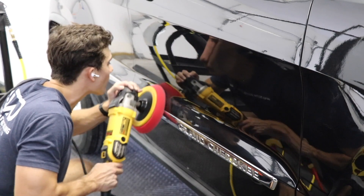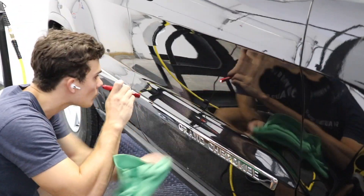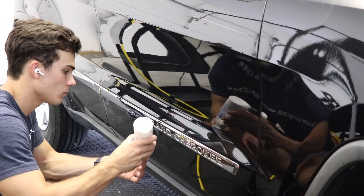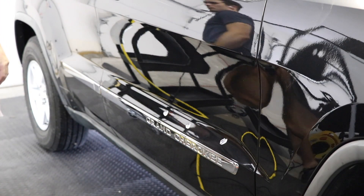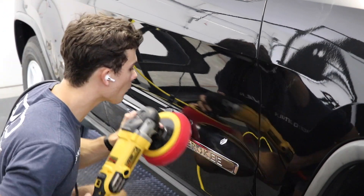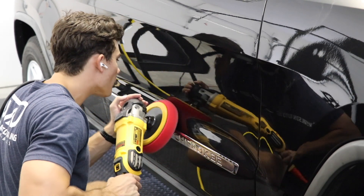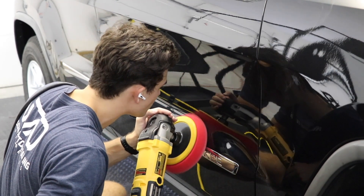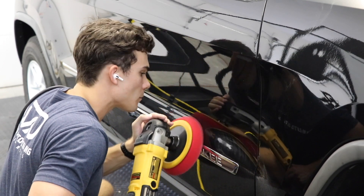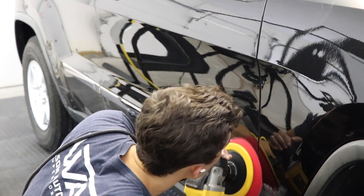To clear up any confusion, the two main reasons I pulled out the rotary: number one, I got to know the paint, I'm dealing with a very swirled panel, my arms are tired, and I knew I could take care of it faster with the rotary. Number two, I can actually manipulate the polisher more conveniently with less arm stress given the shape of the pad and the rotary's motion when working this body line. Those are the two reasons I'll pull out the rotary rather than the DA. If you're looking to get into paint correction or ceramic coating, even as a total beginner, go below and grab my free five-part video series. I'll see you in the next video.